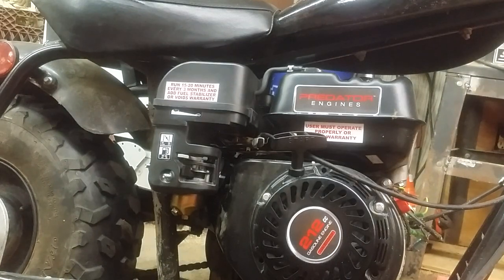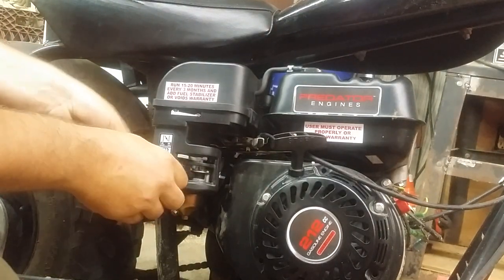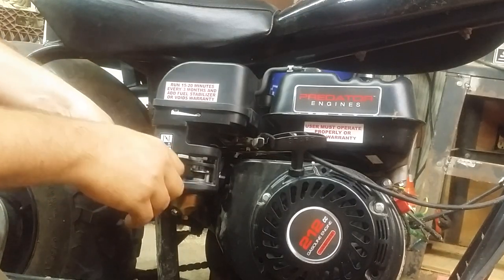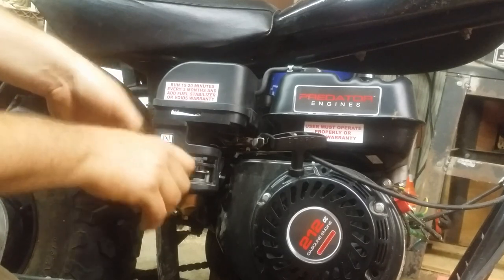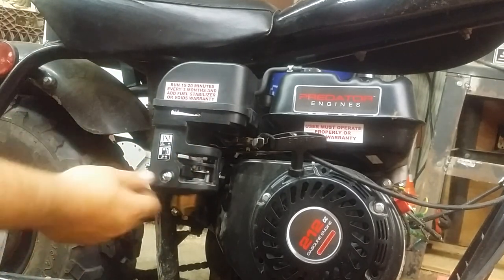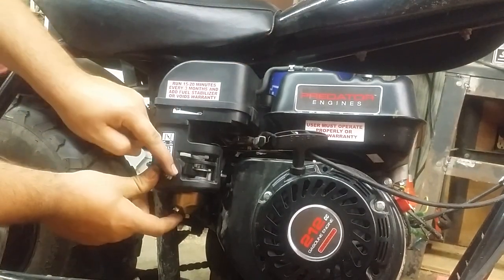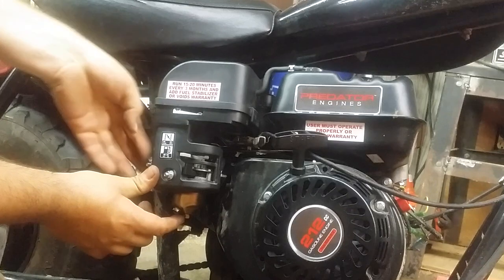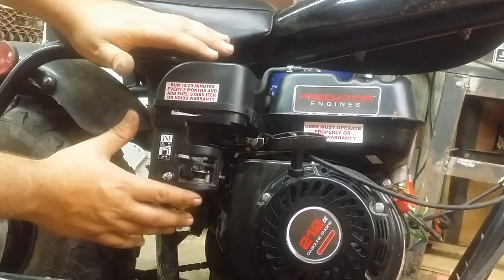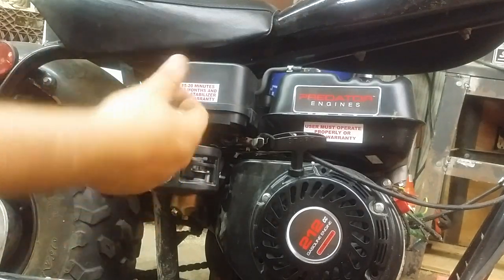Get your two little nuts that hold everything on here. Hand tighten these. Like, literally, use your hands, because this plastic stuff torques and bends super easy. So hand tighten. They're as far as I can move my finger. Push this, wiggle it, finagle it. Try and spin a couple more turns, because it's super easy for this thing to be slightly cattywampus. Tighten these down with a wrench and there's an air gap and it will not run right.